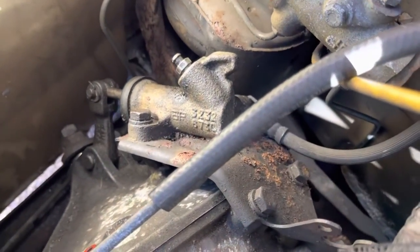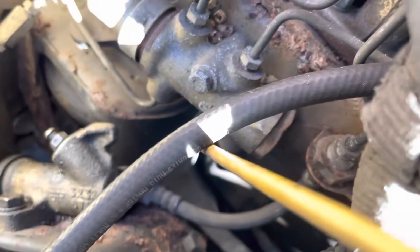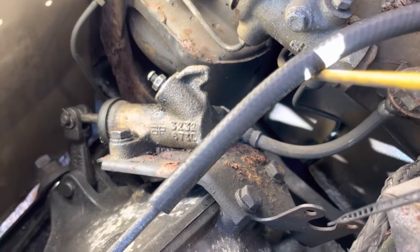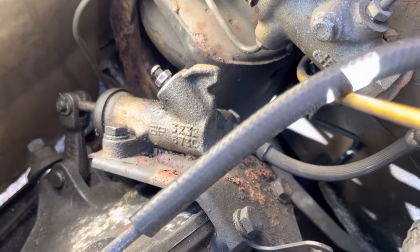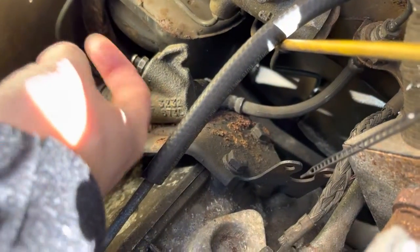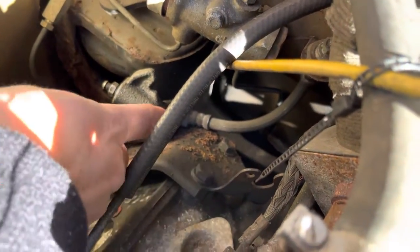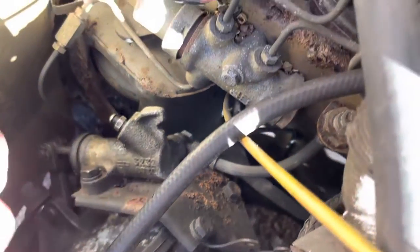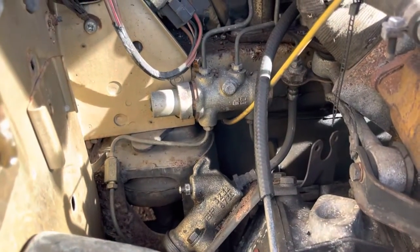Mine has got an original AP Racing part — AP have made lots of bits for these cars. If you buy a replacement now it wouldn't be badged as AP, though it'd be made with the same AP tooling. This is a Verto type — it basically has the nipple going that way but with a little hook, almost like an L-shape going back on itself. On a non-Verto type, the nipple would be right on the very end facing outward.